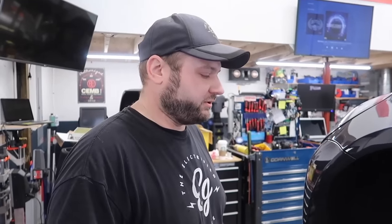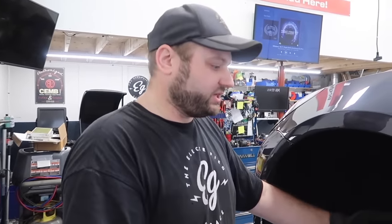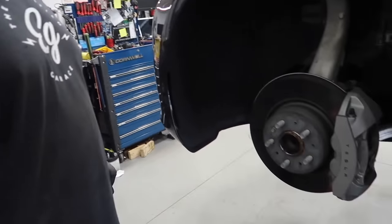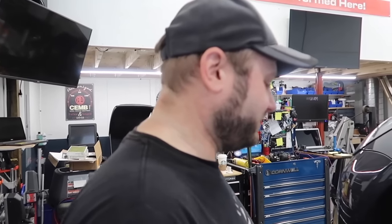Here in New England with harsh weather — and other areas like Michigan with a lot of salt, sea air, and lake effect — things tend to rust more so you want to protect them. I've seen pads where the inside pad looks almost new but the outside is completely worn because the inside pad sticks. All it does is push one pad in and out, which affects braking power. You'll notice a huge difference — if you had stuck pads and then fix them, your brakes are much more sensitive, responsive, and have a lot more braking power. Whereas if you don't do that, you're standing on the brake pedal and not going anywhere.